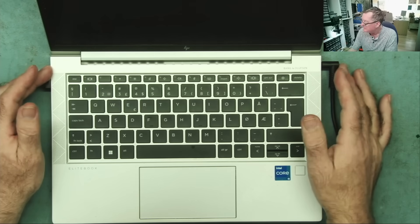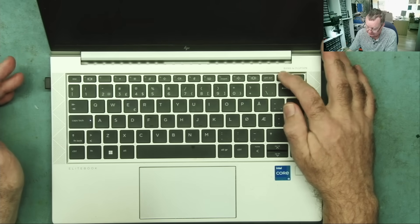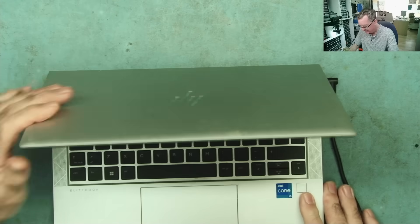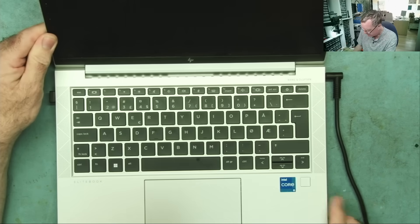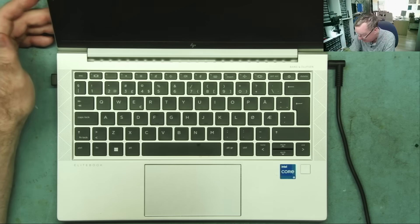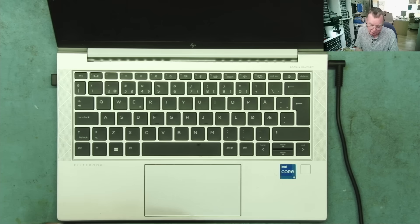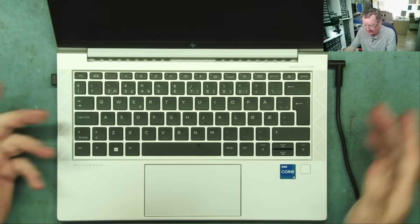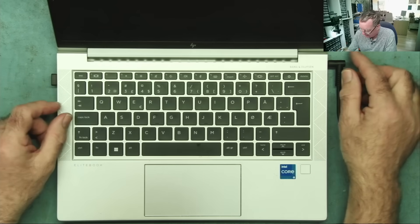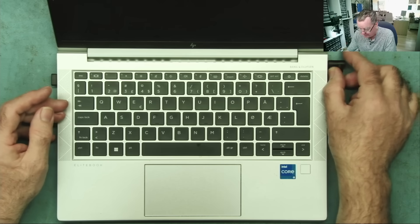She's brought me the charger with it. I can just power this up from the charger, and she says normally you would just press this button and it doesn't boot up — nothing happens, I don't see the fan. They've gone for a coffee and I suggested: leave it with me for an hour, if I can fix it in an hour it's fixed, if I can't, I'll just have to tell you what's wrong with it. So, can we fix it? First thing that springs to mind is the usual problem where the BIOS or rather the EC is screwed up and doesn't want to start. So let's open it up and have a look.